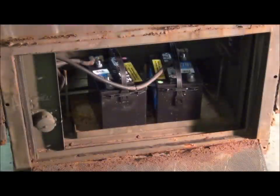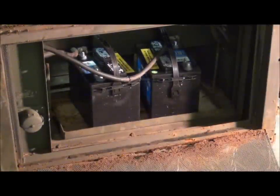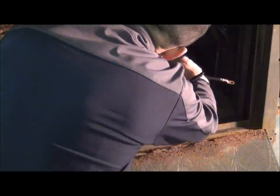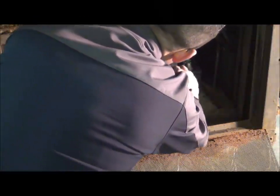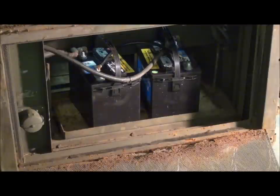I've got the batteries installed in the tray but don't have them tied down yet. We're missing the jumper cable necessary to wire the two batteries in series. I could wait for the parts store to open and get a prefab battery cable, but I keep battery cable and lugs in my shop so we'll just make one up to the necessary length. Now that we've got these batteries hooked up, I can go ahead and button up this panel and move on to the next one.